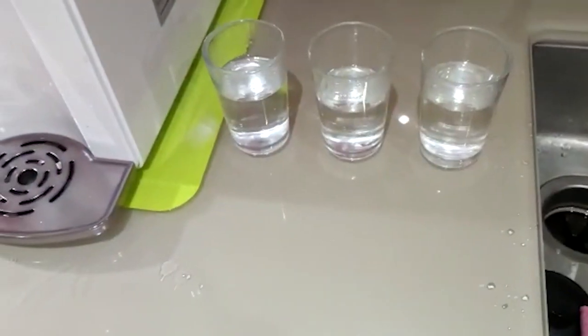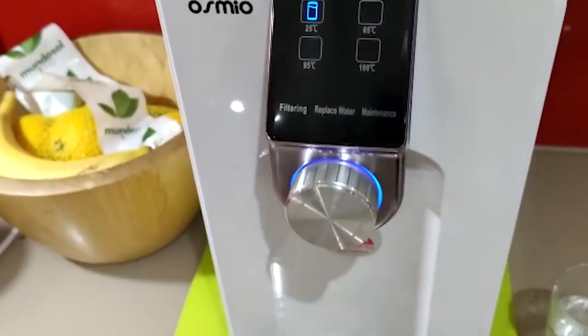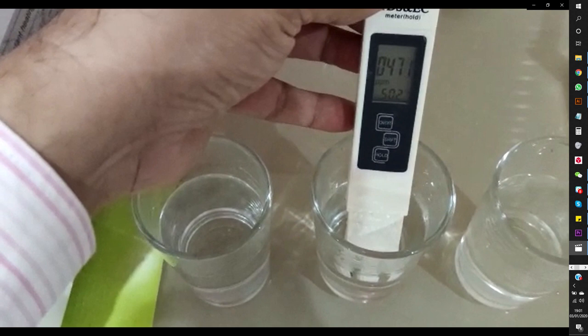There you have it. I'm recommending this machine because it does what I want — it gives me good quality drinking water. The incoming tap water into the Quooker boiler was about 274, and the outgoing TDS of the Quooker was 471. So there was an additional 200 parts per million of TDS added — every liter that family has been pouring into their cooking, tea, or coffee has had this extra 200 ppm.